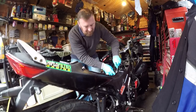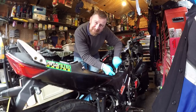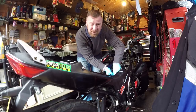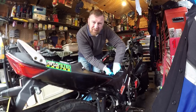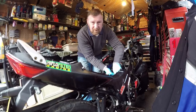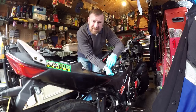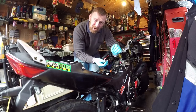I actually went online to see if I was really that daft and not understanding what to do with this bloody carburettor. I thought there must be an easier way of tuning it. There are a couple of videos with loads of views, and all you see is: it's not working, now it is working, haven't I done well? He didn't show anything. And then the guy says if you take it out you get more fuel in — no, you get more air in; tighten up for more fuel.